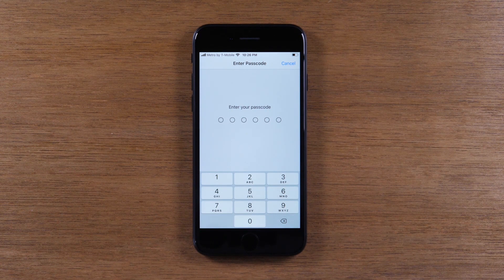Don't touch the phone — let it restart. It's going to restart a few times, and you'll know the reset is complete because it will ask you to select a language. At that point, your phone is fully reset back to factory settings.